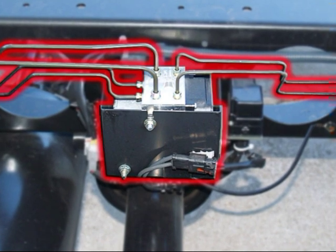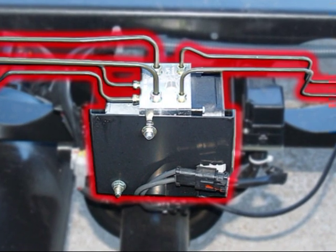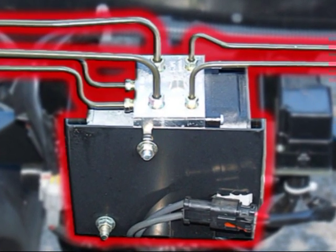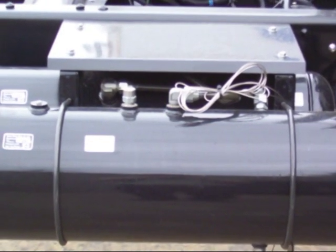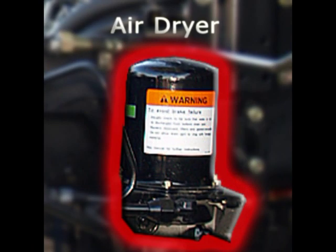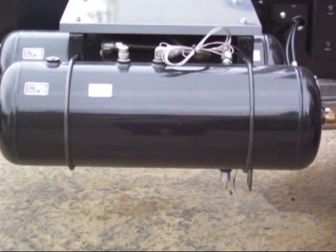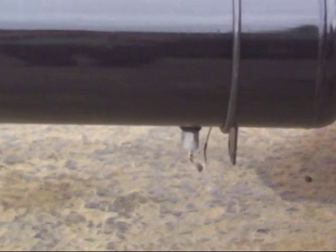The anti-lock brake system module monitors rotational speed of all wheels based on signals received from each wheel sensor to equalize the braking force between all wheels, creating a smooth stop and minimizing uneven brake wear. The front and rear brakes have separate air reservoirs, air boosters, and hydraulic cylinders. The air compressor draws fresh air from the engine air intake system and pumps it through the standard air dryer on its way to the supply tank. Air flowing from the air dryer to the primary reservoir has lower relative humidity, which reduces the need for frequent draining of the air tanks and improves reliability while reducing maintenance.